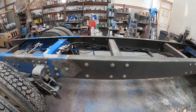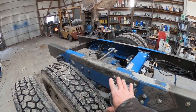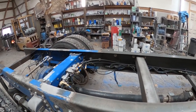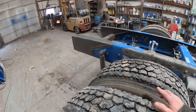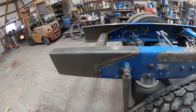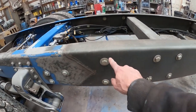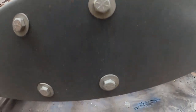Now this chassis looks just like it did before. How can you even tell that I sandblasted it? Well, for one thing, most of these chassis aren't painted — they're powder coated, and that stuff doesn't come off for anything. You've got to chew on that stuff for a day to get it to come off, and it's not necessary that it does, especially on a chassis like this that isn't going to be on display. What I want to make sure is we get all the nooks and crannies. The way you can tell I've gotten it is all that rust is gone — even through around the paint. The stickers that were on the side are gone — got blasted off. You can see the effect that sandblasting has on paint versus powder coating. Another way you can tell is all of these brand new bolts they put on this stretch chassis are no longer shiny gold — they're sandblasted, satin-looking silver, which means they've been sandblasted.